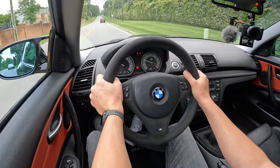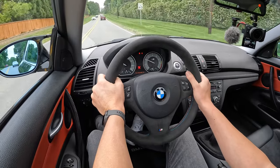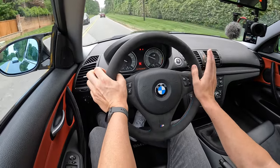The other thing that's going to happen next week is I have some really fun additions to this car. The first one, I'm doing the rear hub conversion on this car, which is, I think, a pretty interesting one. Basically, I ordered all of the components, and I'll put the part numbers down below, but what it does is it changes out the rear hub to allow 10 millimeters more of wheel and tire in the back.